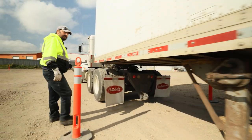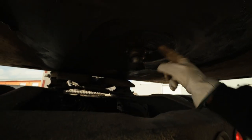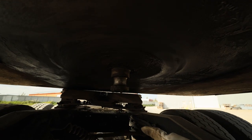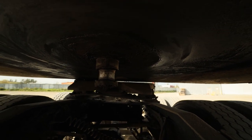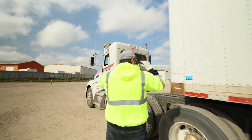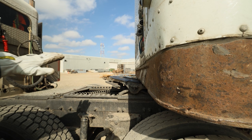At this point we're going to go back underneath and inspect a few things. We're going to make sure: king pin — no cracks or damage. Coupler plate: free of any cracks, fractures or damage. Jaws are open and nice and straight, pin to the slot. A little riddle I use: pin, plate, open, straight. I'm going to verify the fifth wheel to the front apron of the trailer is perfect height. If this trailer was up too high at this point, I would adjust the trailer height with my landing gear. So I'm now ready to get in the truck.